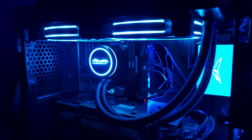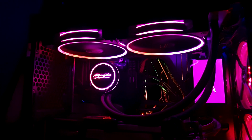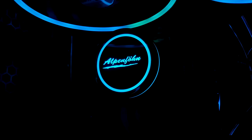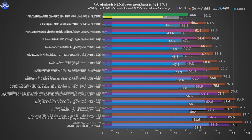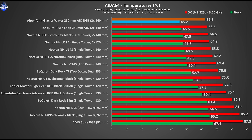Now let's see how it performs. This setup is the same as in my previous reviews — I'm using the Ryzen 7 1700 overclocked to 3.7GHz at 1.325V. All CPU fans are left on the standard RPM curve to simulate real life usage patterns and the same for the AIO pump. The side panel is attached and the front case fans are set at a fixed 30% RPM. In Cinebench R15, the GlacierWater takes the lead over the PureLoop 280mm AIO, the only other watercooled system in the charts, because the fans have higher CFM and static pressure. Thus we have a new champion. In R20, the overall hierarchy is preserved and differences aren't that big but it's still a win. In AIDA64, isolating the stress test just for the CPU gives the highest stress scenario, and even here the Glacier Water keeps its lead.